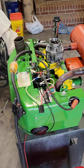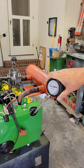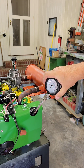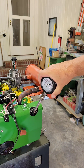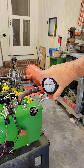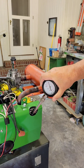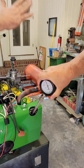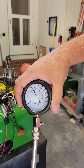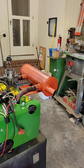That's all we got for this. The condenser hooks to the positive and negative side. In this next short clip of the P218 testing — it's the P220 same thing — we're going to do a compression test. We got the motor warmed up. The right side cylinder is where we're starting; it's supposed to be 75 to 115 PSI. Let's put the battery up and try it. We got 114 PSI — excellent. Let's stop there and we'll open the other side and check it.